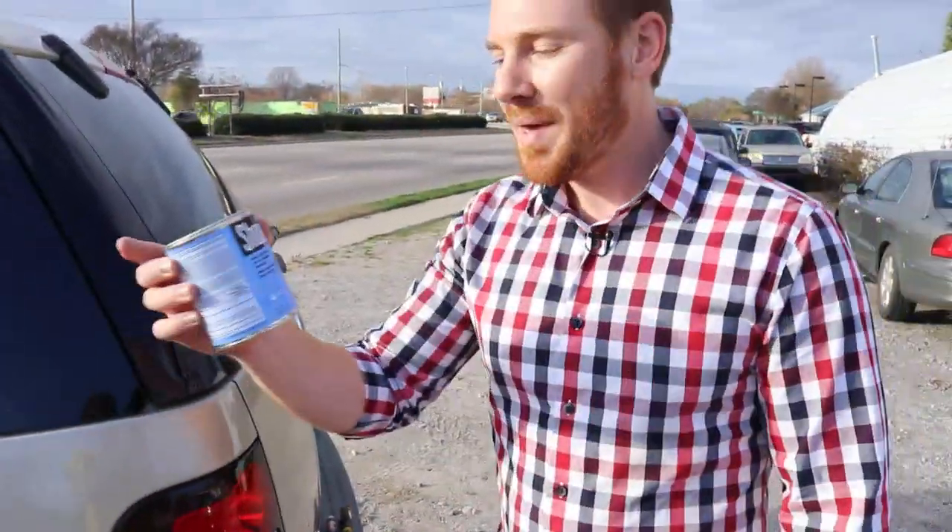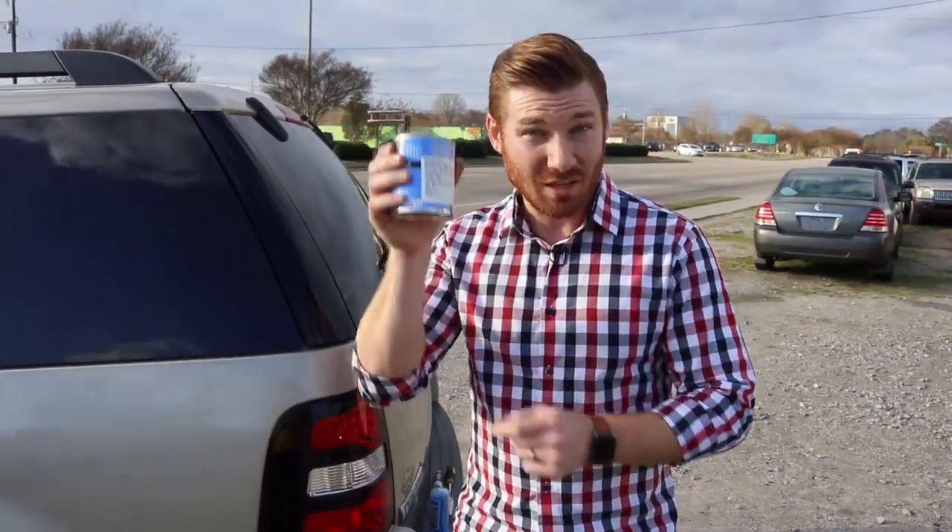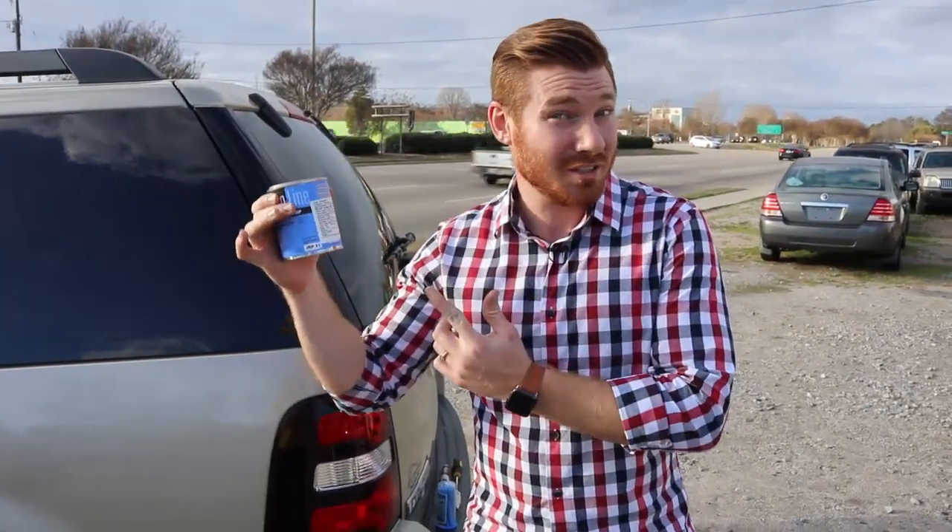For us, we've taken G3 and I called an auto body supply and had them mix this for me. This is four ounces of G3 Ford for a 2007 Ford Explorer. That code for another year model could be a different color, so you want to make sure it's specific if you're having the auto body store mix it for you. I had them mix four ounces for $14.37.